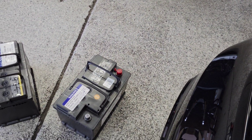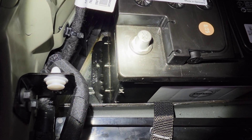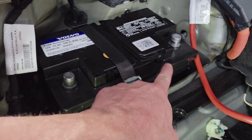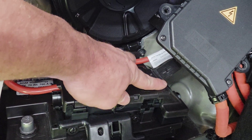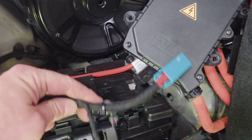With the battery removed, it's time to install the new battery. Re-secure that clamp with the 7 millimeter bolt, re-secure the battery strap, then reinstall both positive first and then negative battery clamps. Reinstall the positive battery clamp, tighten the 10 millimeter down, and then reinstall this wiring harness.